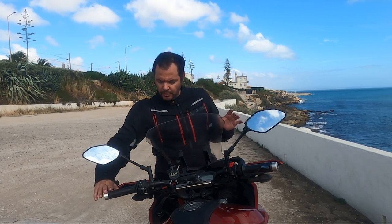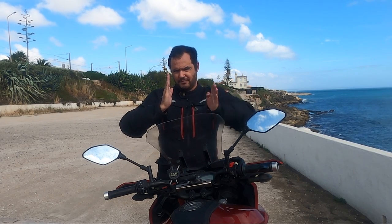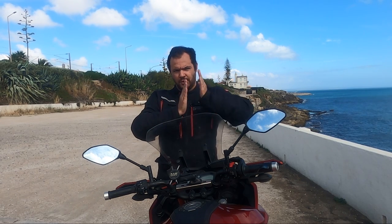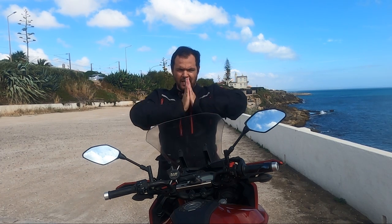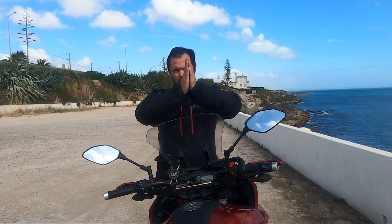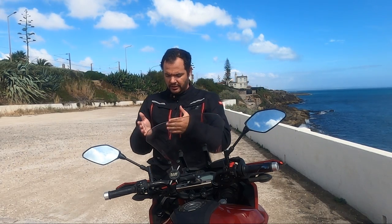And how does the clutch work? When you press it in like this, these two discs separate. So now your engine is rotating, but your wheels aren't. You're stopped. When you want to start again, your engine is rotating but the wheels aren't, so you release the clutch so that it starts touching the other disc. With this friction, your wheels start rotating until these two discs are synchronized, rotating at the same speed. Now your engine is directly pushing your wheels. If you go faster, it'll spin faster. If you go slower, it'll spin slower. And when you want to come to a stop, you just separate them, brake the wheels, and the engine keeps on ticking over. This is all the clutch is.